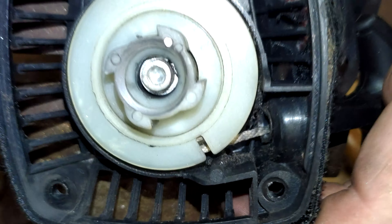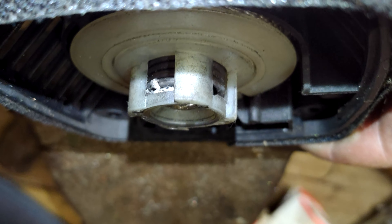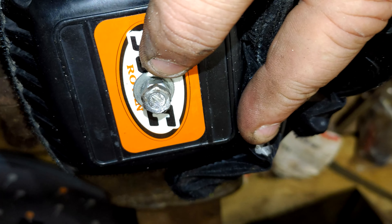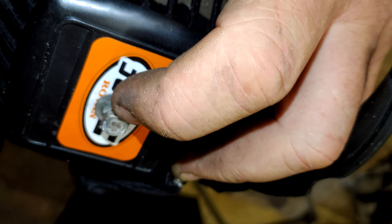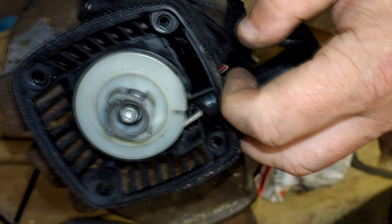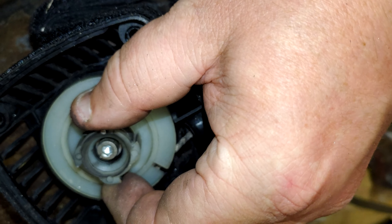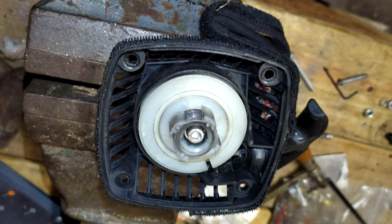Basically we're aiming for the bolt all the way back through the hole, the spring where it should be, and on the back I've gone for a bigger washer. I didn't have a locking nut so I've put a nut on and tightened one down against it, then cut the top off to keep it in place. What we should have now is a working pull start where this can't move forward, so it can't fall off that spring. Let's get it back in the car and see if it works.